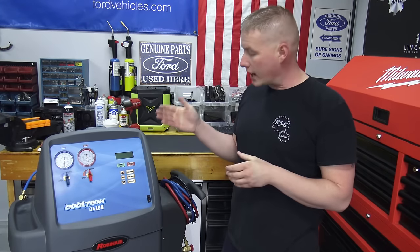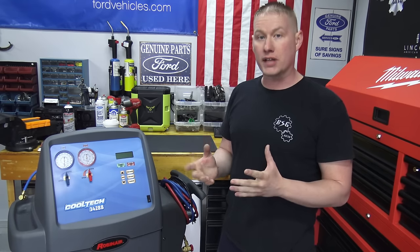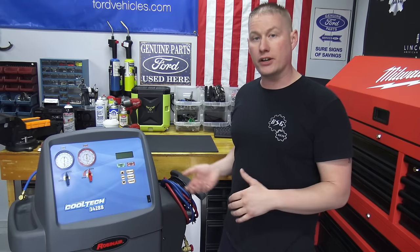Welcome back to the shop. Today I want to kick off my AC repair and diagnosis series with a full-on demonstration of this recovery machine. The reason these machines are important is because a dealership or independent shop can use them as a diagnostic tool. These newer AC systems are so much smaller, and their tolerance level has gotten much smaller for the correct charge level — a little over or a little under and the system can actually act erratically.